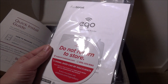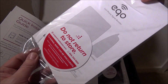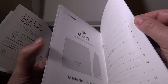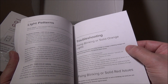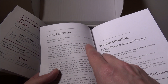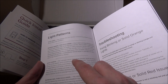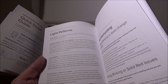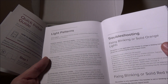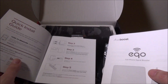Keep in mind that signal bars don't equate to actual decibels, so measure in dBm if you can. You also get a user manual in multiple languages and your two-year warranty. As for the light patterns: solid green means the booster is functioning properly with no installation issues; solid orange means one or more booster bands have shut off due to strong signals; blinking orange means strong cell signals from a nearby tower that may not be your carrier.